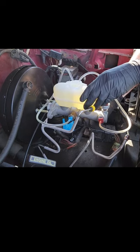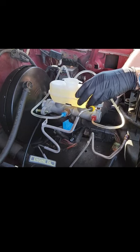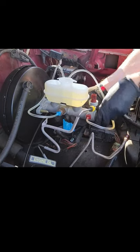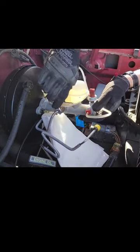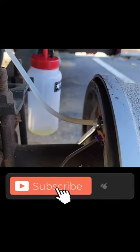I'm going to have another video coming out soon that shows this procedure, however I do want to mention a few things. Make sure you do not remove the fittings or the clear tube until you are ready to connect the brake lines back on. Also when you are ready to connect the brake lines, make sure you do one at a time. Do not take off both of the fittings and then rush to put the brake lines back on. And finally, make sure you bleed the brakes after you finish.